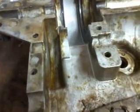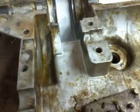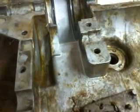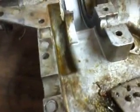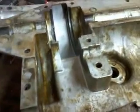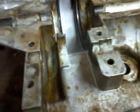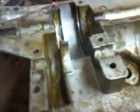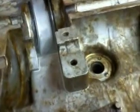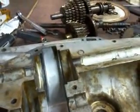And the reason why is because over time the grease will be thrown away from the gears, and it won't really come back to the gears, so to speak. Whereas gear oil, it's thrown away from the gears, it comes right back, and continues to lubricate them. So really, gear oil is better for that reason right there.